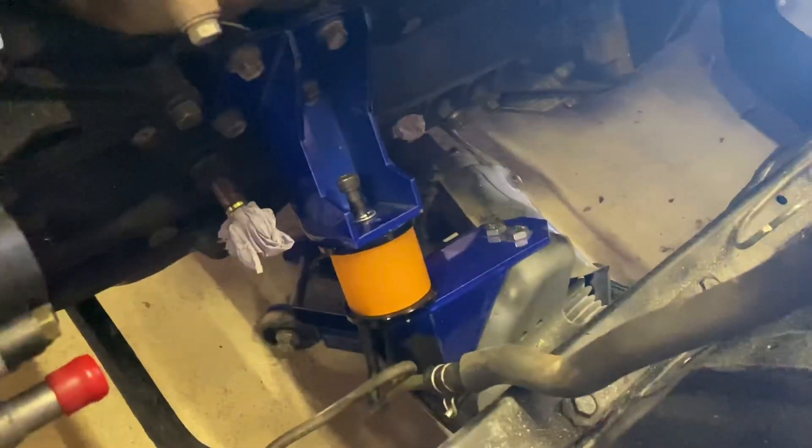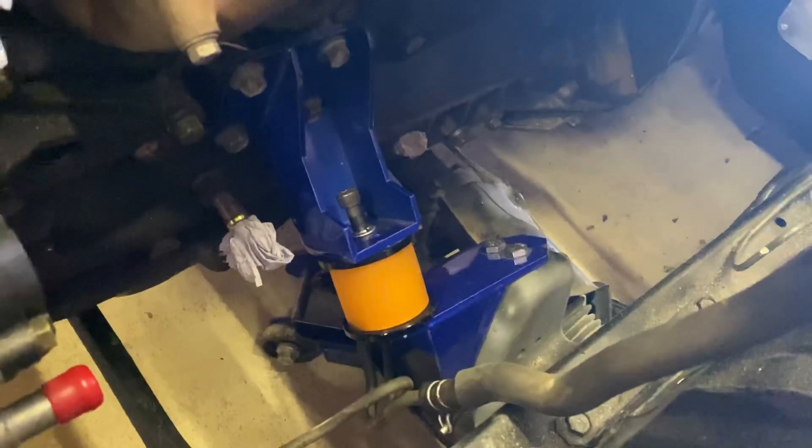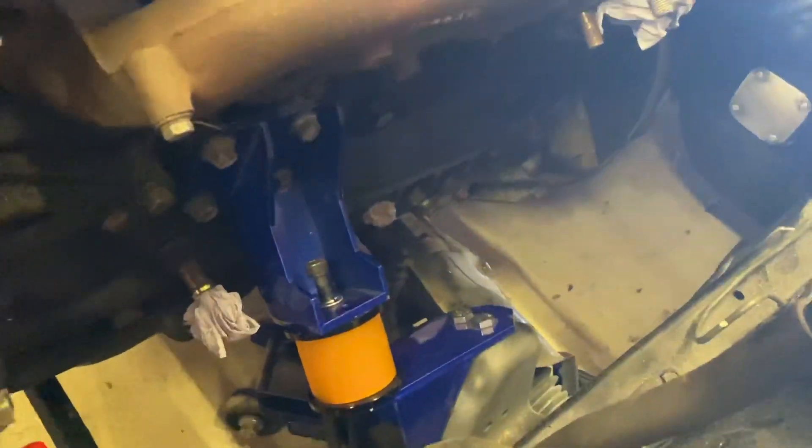On this side there's still quite a bit of space to move around, so we're just going to pull those bolts out of the poly bushing, get the engine mounts off, then get the gearbox mounts off and pull the engine.